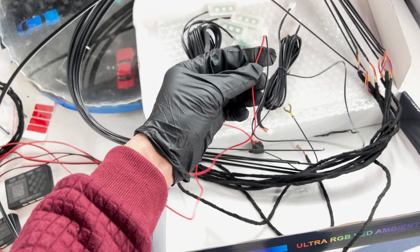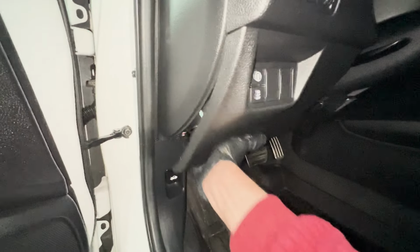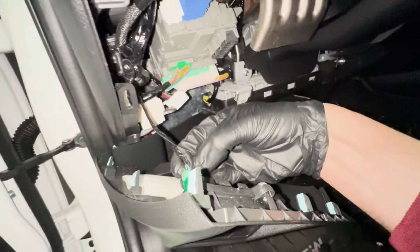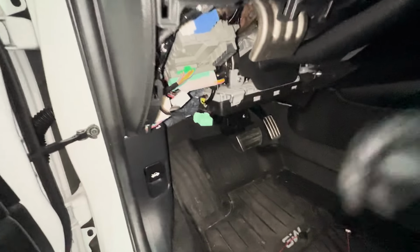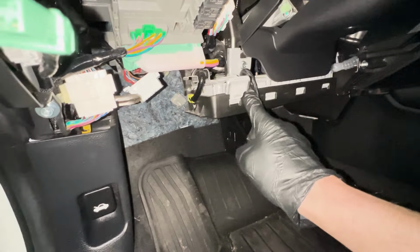All right, so under the steering wheel, literally just pull this tab here, and then come right off on the side as well. Unplug the plugs here, so you can put this on the side. This is what we're going to use for ground, 10 millimeter bolt. And we're gonna use this if you have the spot filled up. If not, I use a spare fuse on this side for anything for accessories basically on this fuse, bottom right. Unless if you don't have space and whatnot,